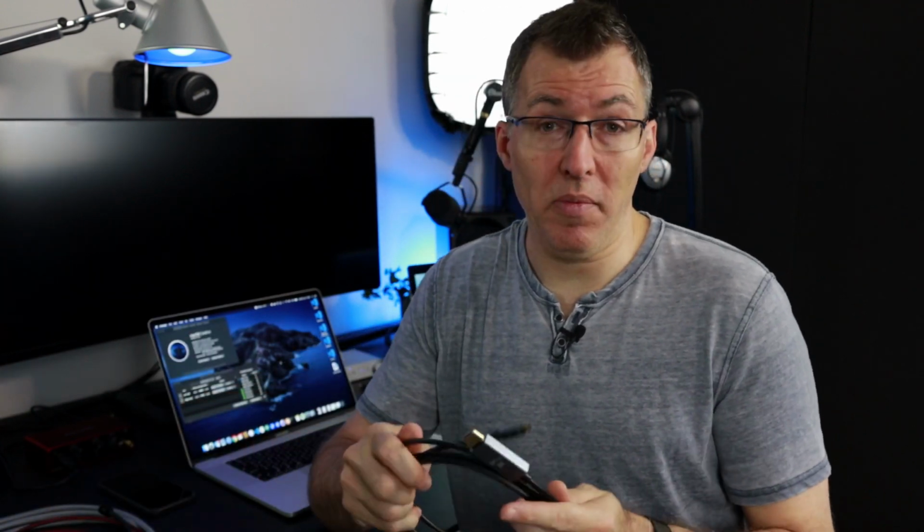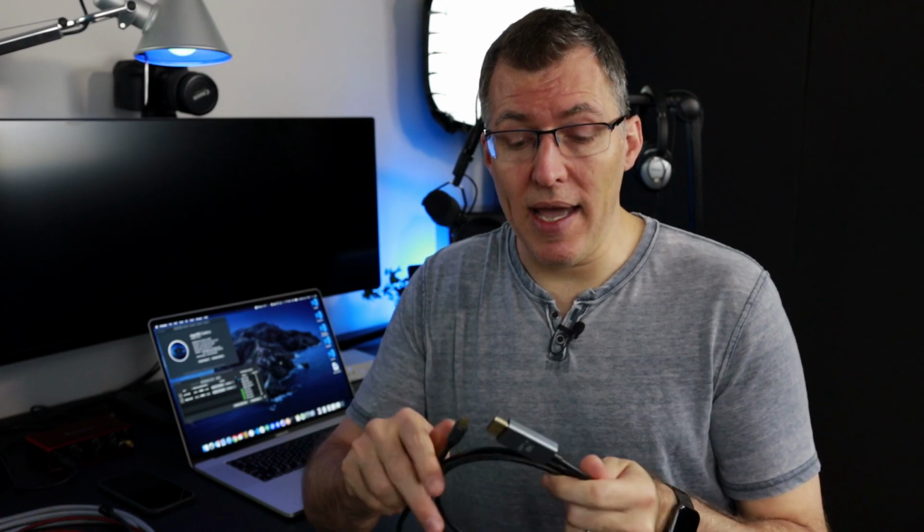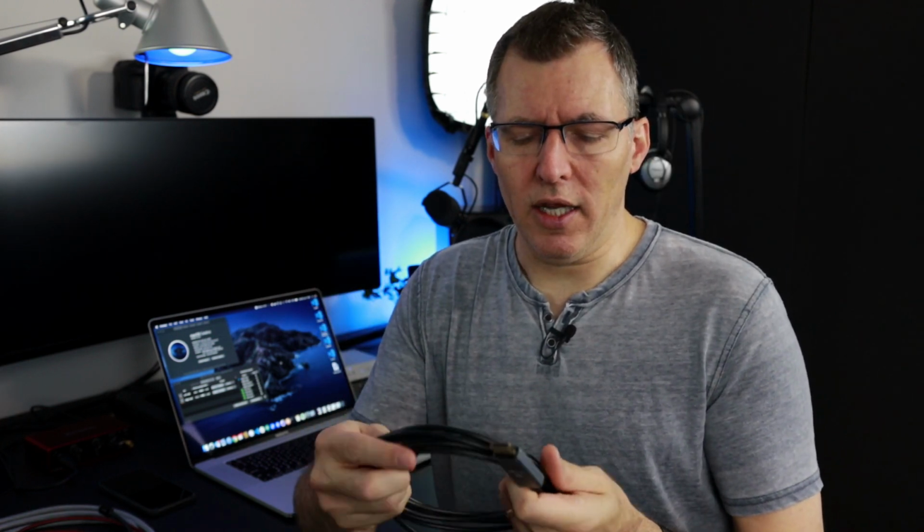Now, what ultimately did end up working for me is that instead of going HDMI, I actually went with a DisplayPort cable from the MacBook Pro to my monitor. One of the things that a lot of people might not know is that if you connect with HDMI, you actually do have to go through some type of conversion process for that connectivity to work. So from USB-C into some type of thing that has some chip in it that's going to do the conversion to HDMI and send it out to the monitor, whereas USB-C and Thunderbolt 3 support something called DisplayPort alternate mode, and so you have a more native connection when you go from USB-C to DisplayPort. And that may be something that's playing a role here and why it worked for me.